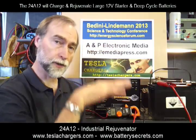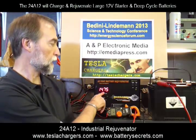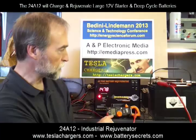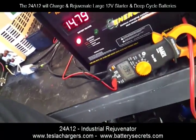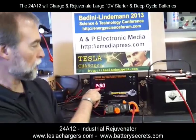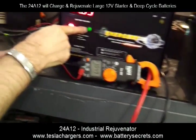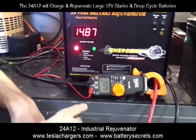This type of charger is excellent for rejuvenating batteries that have been chronically undercharged and bringing them back to full service by being able to top the chemistry. The battery rejuvenation process involves a number of topping charges, then discharges, and then deeper and deeper discharges until you can resolve all of the sulfation left in the plates. Here we can see we're up to 14.76 volts now, and we're down to about 11 amps. Anything above about 14.8 and now the machine is starting to roll the currents off — you can start seeing that the green light is starting to flash.